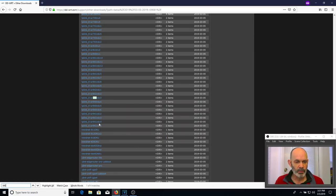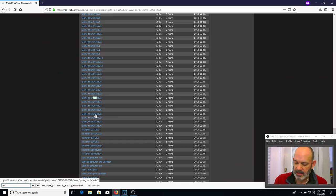Choose the one corresponding to your router, but make sure you get the right one. There's a 941 here — this is not a 941, this is a 940. Make sure you get the right one for your router. Can't stress that enough — right version, right model number. Do this wrong and you're going to be in a world of hurt. I may make a video on how to recover from a bad flash, but there's always a chance I won't be able to.